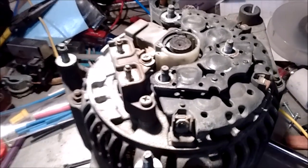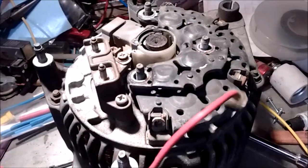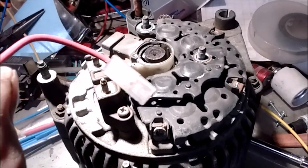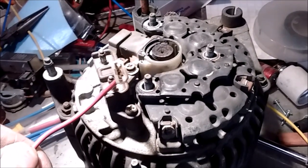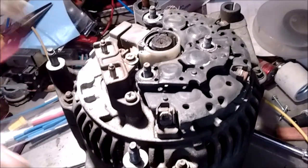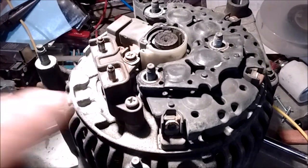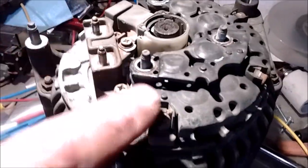I'm going to hook this wire to there, which I have a connection here. If you watch my powder coating oven videos, I saved my wires from appliances. I like this because it has a plug — that way if I ever have to get a new alternator, I can just rob all my pieces off and put it on the new alternator. You need to hook this wire to your stator to give you a W wire for the tachometer.